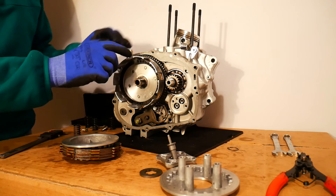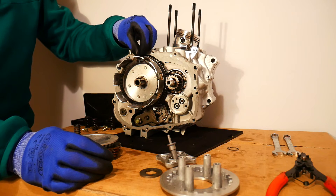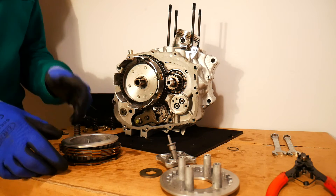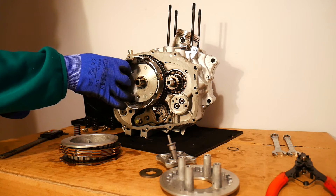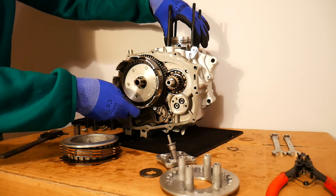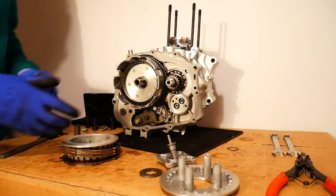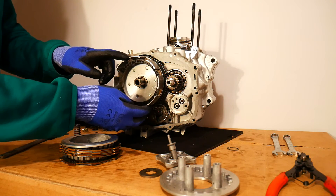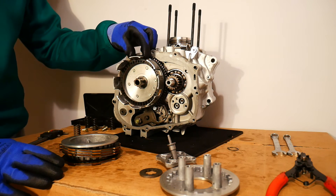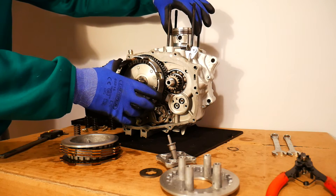That scraping motion means the grooves in the clutch basket can wear over time. If there is too much wear, when you pull your clutch you might find that a plate is actually catching in a little groove. Check your clutch basket for grooves — it should be perfectly smooth all the way around, which allows the friction plates to move freely. If there are any grooves, you can possibly fix them by using a small metal file. It rarely happens, but it's something you're meant to check.